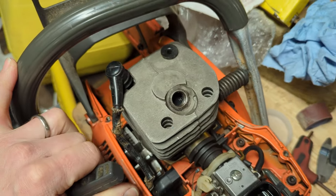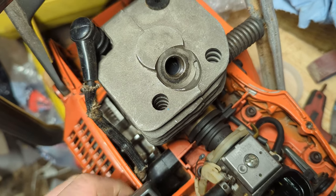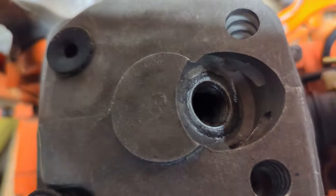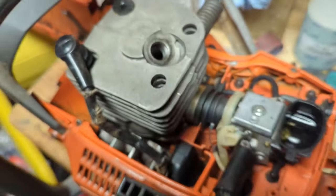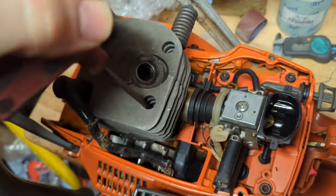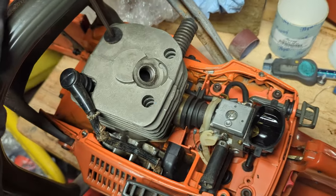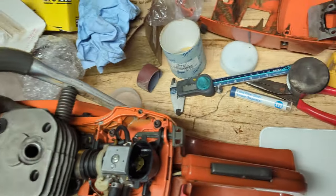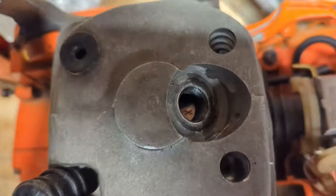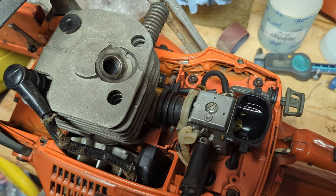Well, I don't know if you're going to be able to hear this, guys, but this is the noise something makes when you set it up with the squish too tight. You can just hear the piston kissing the top of the cylinder. You can hear that metallic tap that if I just undo this a tiny little bit, and I undo this one a tiny little bit, will have gone. So just a few turns undoing those. And that metallic tap as the piston comes up has gone.